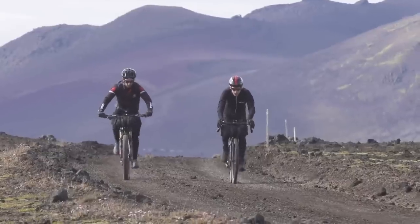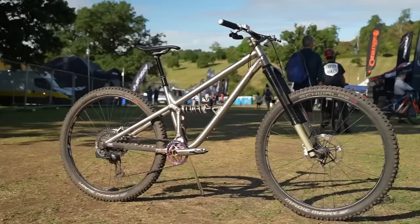Another really cool thing about titanium is its very unique ride quality — you'll hear this from titanium bike owners. It's similar in some respects to what you can achieve with steel; something like Reynolds 753 has a nice springy nature to it. Titanium has that in a slightly more dead, dampened feel — really hard to describe. It's a nice springy, resilient feel somewhere between steel and alloy. Titanium is technically an alloy — it's not pure titanium; you have to mix in additives to make it workable, otherwise it's too soft. But the material is incredible and makes beautiful bikes. When it comes to full-suspension bikes, the jury's out on whether it's better than steel or if you lose some of the properties.